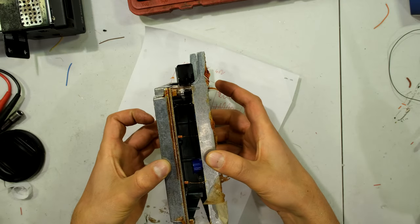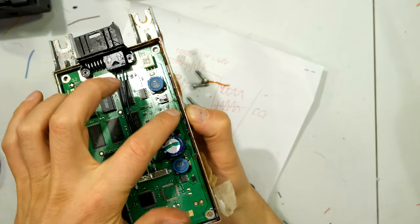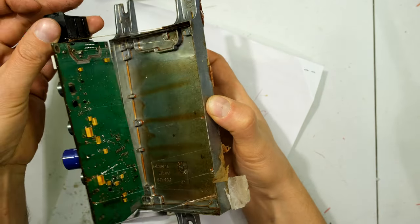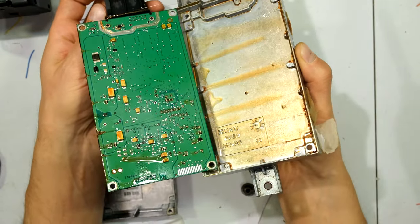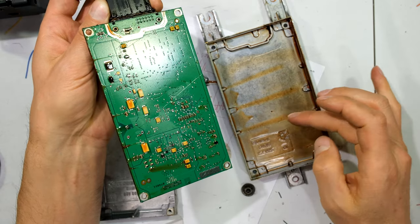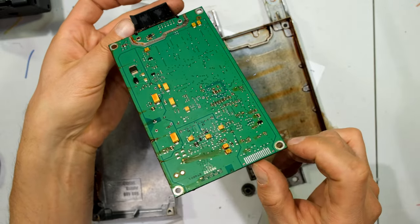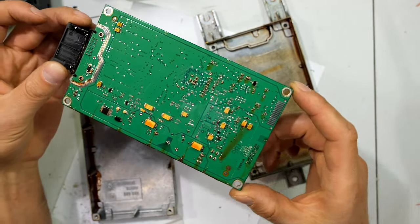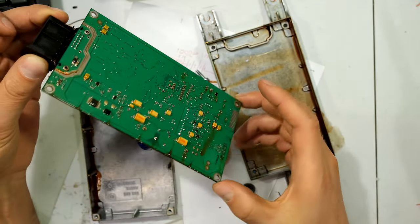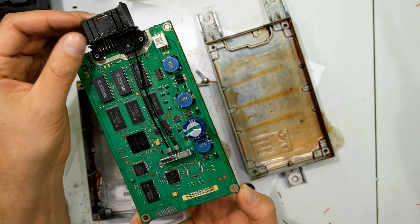That's already telling me there's a problem — I can already see some residue there. If I lift this out, it's very sticky inside. It has some immersion in the transmission fluid — that's the fluid I use on the hydraulic pump to open the boot. We can see the residue, which means the fluid used to open the boot has leaked into this SVS unit and is possibly disturbing the MOST bus, resetting my system because it's in a ring.